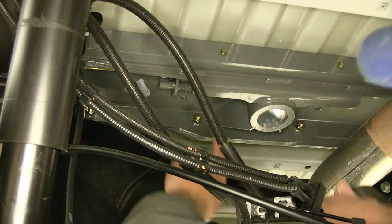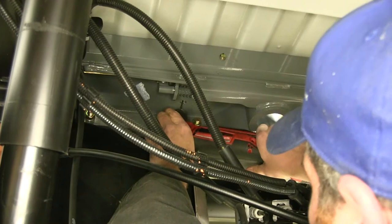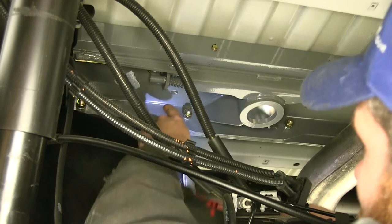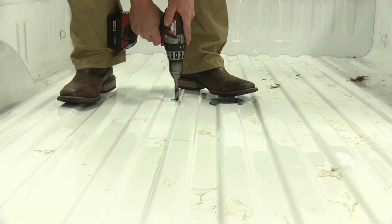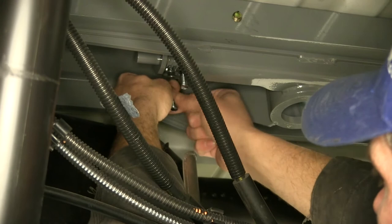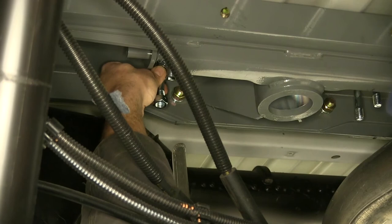For our safety chain connection points, you can try to drill a half-inch hole up through the bottom, but as long as those drill bits are, it's pretty much impossible. The best thing to do is take a nice short drill bit and mark the center of each of those holes, go around and do that at all four locations, and then drill down through the top — that'll be a lot easier. Then we'll slide our U-bolts down and slide our springs onto the bottom side of the U-bolts. We'll put on one of our lock nuts and tighten these up so they're flush with the bottom of the bolt, so not too much.